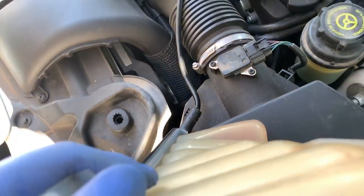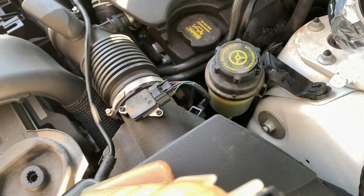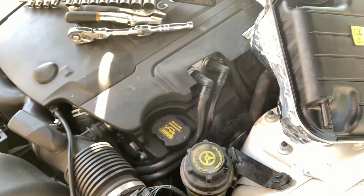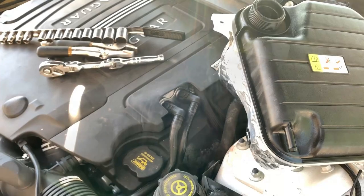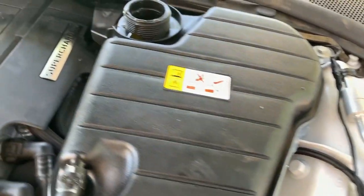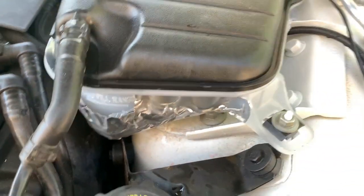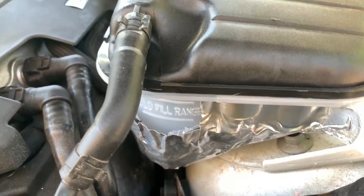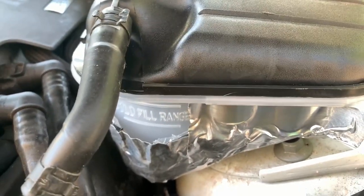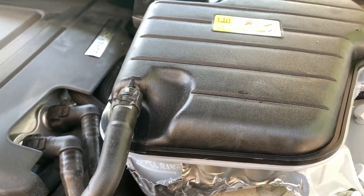You can see where there was a lot of cracking and things going on there. Make sure to use genuine JAG parts — save yourself a headache. It's only about a hundred bucks for this particular coolant tank. I'll post the part number in the description below. With everything all buttoned up and all the coolant transferred back, we're a little low because that was leaking originally, so we're going to fill it to right in the middle of the cold-fill range and we should be good to go. I'm just going to top it off with DI water because it's already got clear, clean coolant.